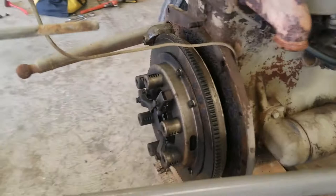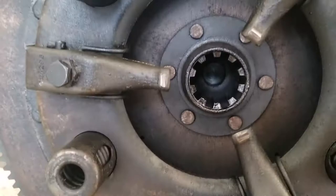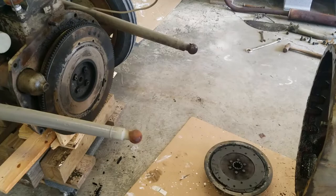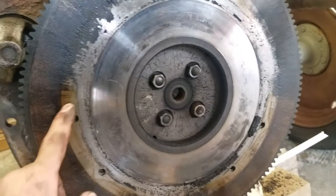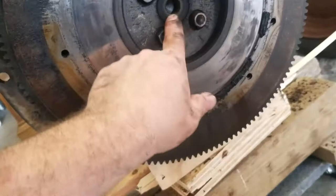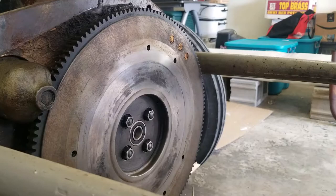Now we're going to go ahead and look at this clutch a little bit. You can tell it's got a lot of oil and stuff around it — a little bit of leaking back from here. We're also going to replace our throwout bearing and the alignment bearing inside of there. It was pretty nasty. I knew it was even stuck on there after I undid all the bolts. So it's kind of clear why it's sticking. Look at all this. We're going to replace that sucker. You can replace this bearing here — see, that doesn't feel like it turns at all. That's probably another reason why it was sticking. We're going to replace all that and we'll get back to you.